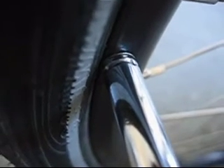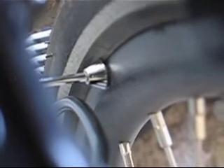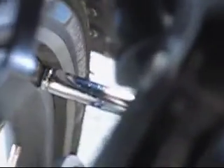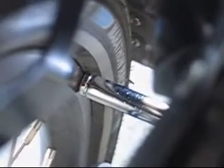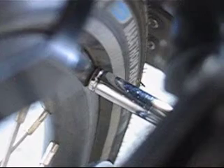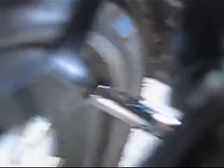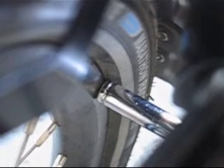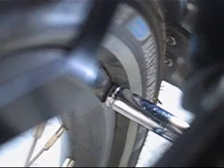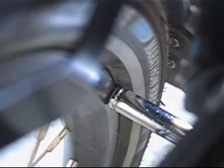We're going to compare this measurement in the back of the inner rim. This is the left back inner rim measurement — you can see that the button is flush to the rim. But on the other side, which is pretty difficult to photograph, you can see that I have a small gap. So this would be our 1/16th measurement that we need. This is the right inner rim at the back of the wheel, which gives us a nice toe in.